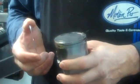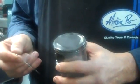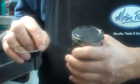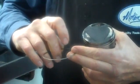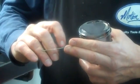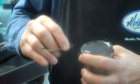Hi, I'm Jeff with Slavin's Racing. This video is about how to install rings on pistons. This is a Vertex piston for a KTM. Most rings — these do, and most other brands do — they've got a letter on top. They usually have like an N or some type of letter, and that indicates which side is up for the ring.